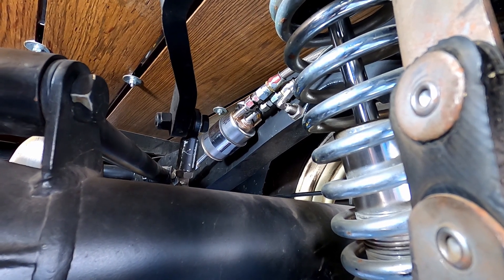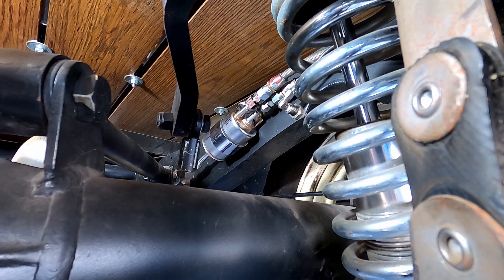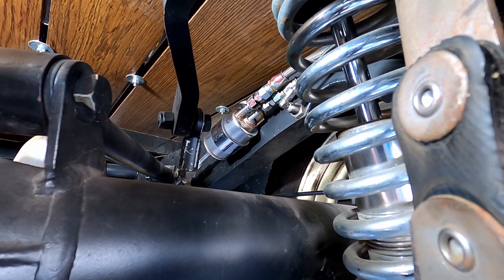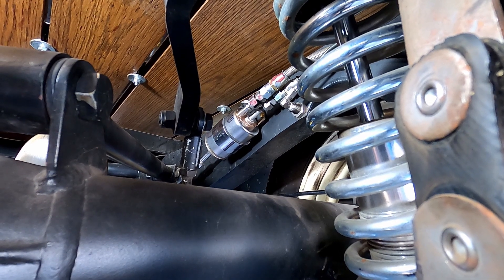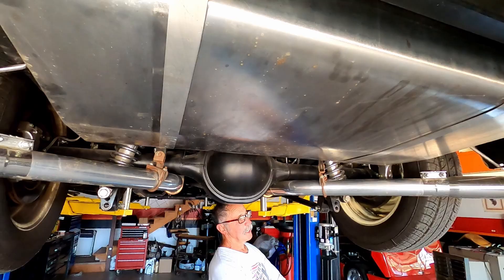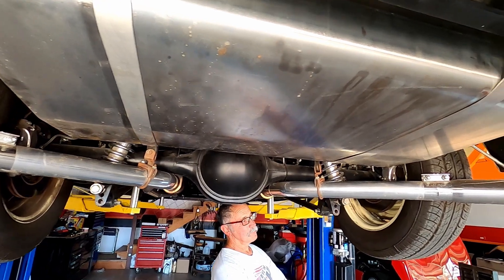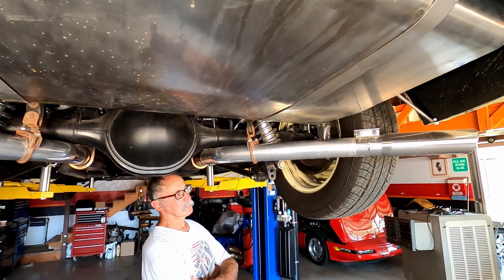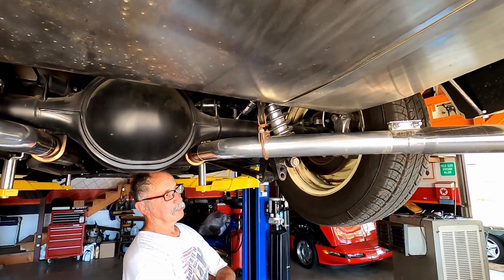That's quite a bit of difference. With that little pressure, I barely got it to roll around where I could put it on my lift and work on it. It would idle after I got it started, but as soon as I shut it off, it would drop automatically down to 0 pounds of pressure in the fuel rail.